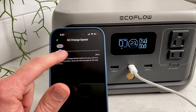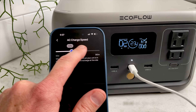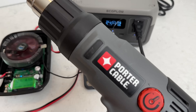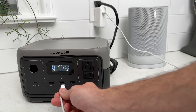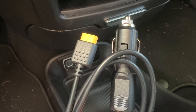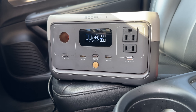You can adjust the charging speed in the app in increments of 50 watts up to 360 watts. At 50 watts it's completely silent; at 100 to 250 watts the fans are a very quiet 38 decibels at 1 meter; and even at 300 to 360 watts it's only 44 decibels. The River 2 supports pass-through charging, so you can use AC, DC, and USB while charging. Connecting both the AC wall plug and USB-C at the same time never went beyond 360 watts — it seems to switch from USB to wall charging when AC is detected. I was also able to charge at 100 watts via the cigarette adapter in my car, so it would take about 3 hours to charge on the road.